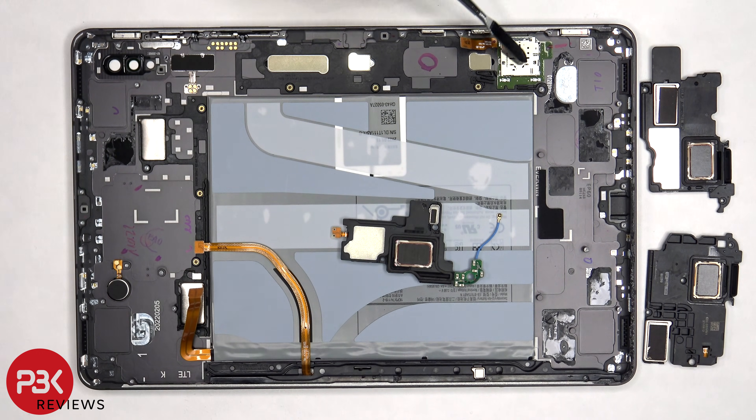The SIM card reader and memory card reader is located here, and it's held down with adhesive so you can just pry it off if you need to. The SIM reader does have the pins, but the software doesn't support it, so it's not enabled on the software of this tablet. And if someone were to enable it in the software, it might not work since there's no IMEI attached to this tablet.